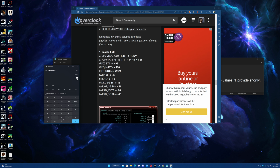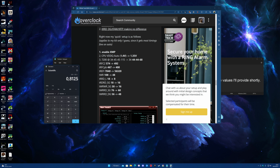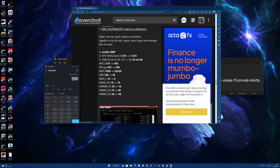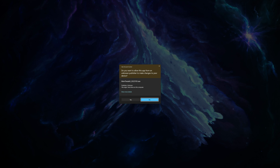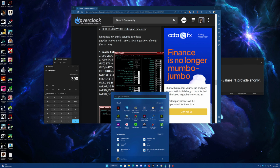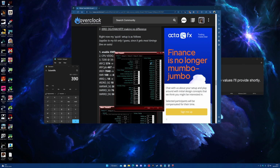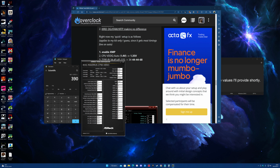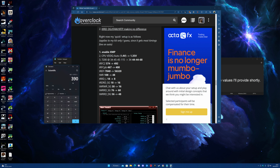So 260 over 320 is 0.8125. So if you go to 480 multiplied by 0.8125, you should be able to do 390 like I'm doing right now. You guys saw a post on 1usmus, 390. Let me show you again. Wait, no, you can't see it in here. You can see it on ASRock. Here we go. I can't zoom in, obviously, guys, but you can see on ASRock I have it at 390. This is doable. In fact, in my XMP profile, 480, 390 is actually the split. So 390 per bank is correct.